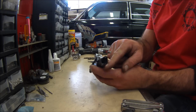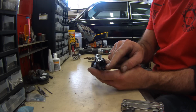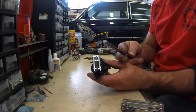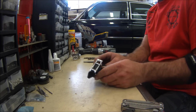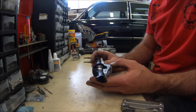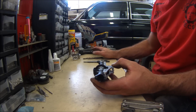I believe I just measured the inside of these tubes come out at like 0.264 diameter. These shafts are 0.277. So we're barely opening up the insides to fit these shafts. So what I'm going to do is something I've never done before, which is to modify this axle housing with regular drill bits and a hand drill.